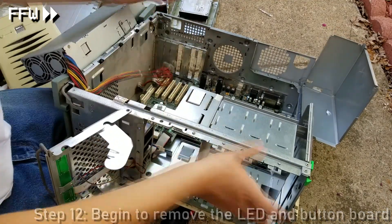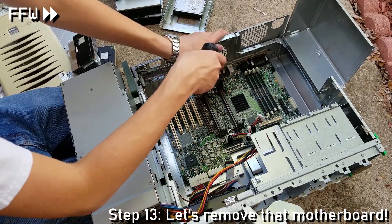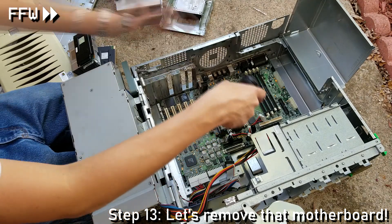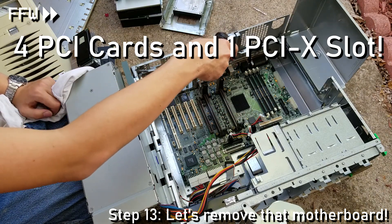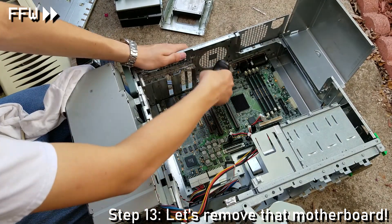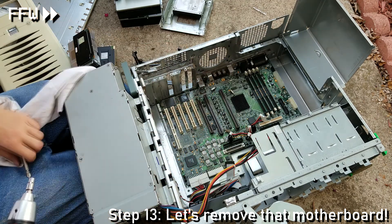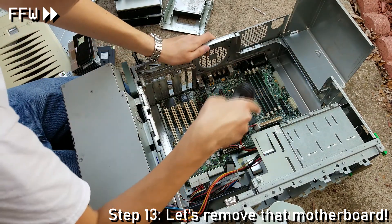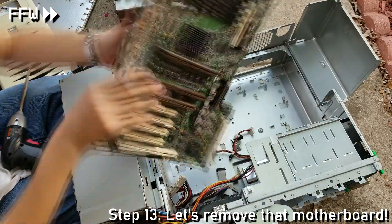I leave the front panel to the side and focus on the motherboard itself. It is quite large — about one and a half times, possibly even double the size of a standard motherboard because it's quite long. It has to fit four IDE drives, two slot processors, and four memory stick slots all in one row, so it's quite compact and big as a result. I take off the brackets holding the slot CPUs in place with a Phillips head screwdriver, continue removing the rest of the screws, then slide the motherboard out. Once I disconnect the rest of the power supply connectors, it is finally freed.